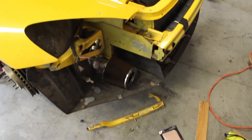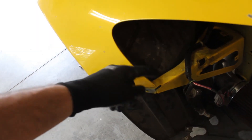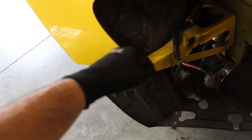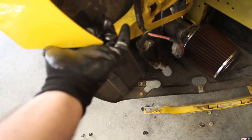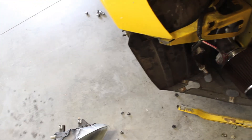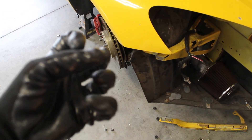Obviously the car is not dipped yet - still yellow. I've got all the wheels off because I have been working on getting the bumper off since that's my stock bumper. Yeah, I know it's a mess - I'm very busy. I did that last night, and I was trying to redo this little edge here. I think at one point this had been hit and this was actually kind of bowed out a little bit more. But I was able to wrap this in here with a bunch of electrical tape and blue tape and just kind of knock it with a piece of wood behind it and get it back straight. I also noticed that I have a bulb that burned out, so I've got to go get a little tiny bulb.